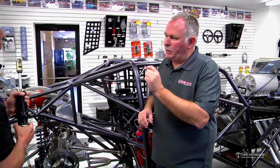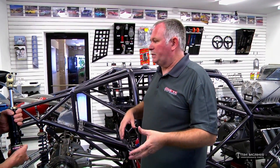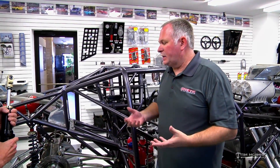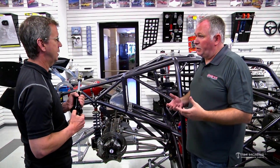One thing to note: if you move it two sweeps and it doesn't do anything, you move it two more sweeps and you don't really see it in your shock travel, then that tends to lead to other things — that's when you want to start looking at the four-link. But typically if the car was happy last night, the four-link is happy, the weight is probably pretty happy. We can make the equivalent of moving 25 to 30 pounds from the front to the back of the car just in shock adjustments. That's a pretty significant move.